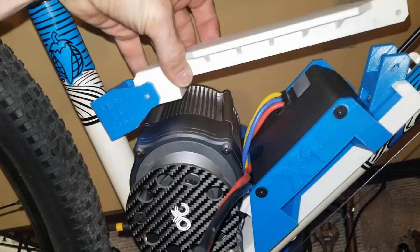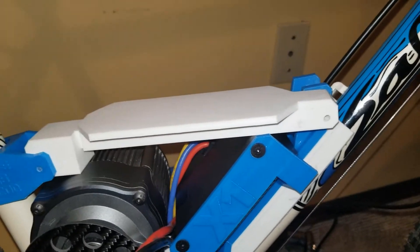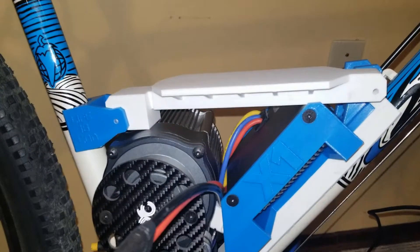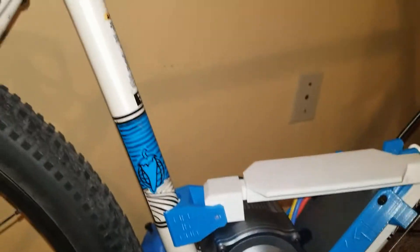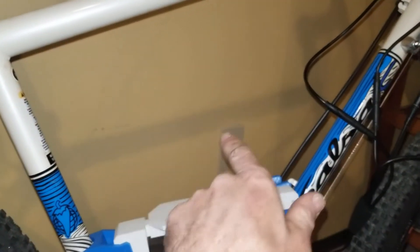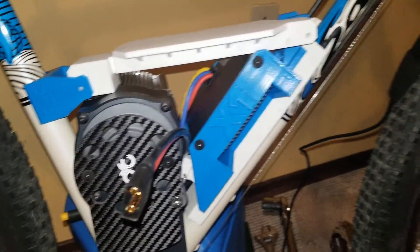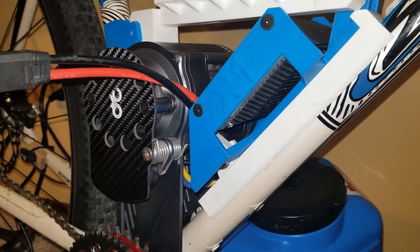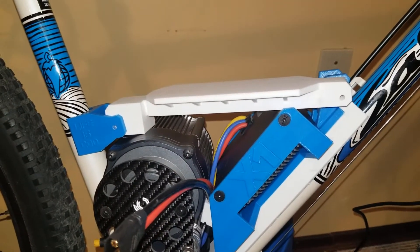The shelf unit simply sits between this mounting point here and this mounting point there, and the idea is that it will take the weight of a future battery pack yet to be built. In the meantime I'm going to use what I've got, but eventually I'd like a purpose-built 72-volt battery sitting in that frame — although I'll have to change out the controller at that point because this one doesn't do 72 volts. If a 72-volt controller fits the same form factor though, I could still use that mount.